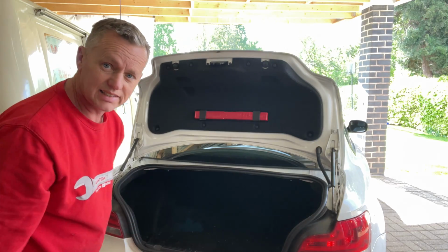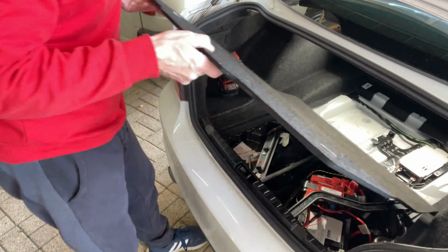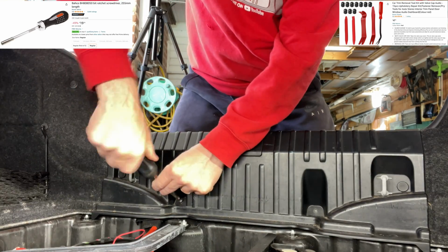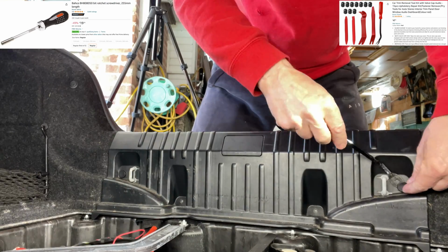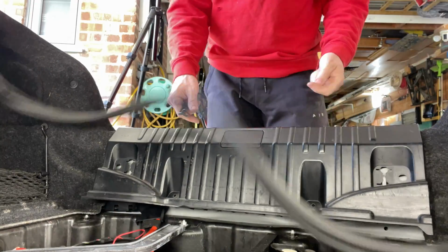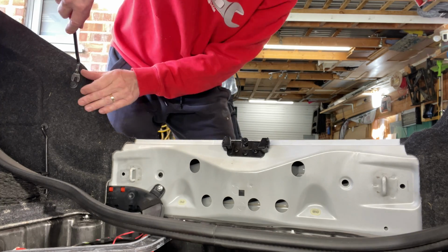Yeah, let's get in there. So first things first, we'll get the boot liner out the bottom. We've got 2 screws on the back panel, just pop those out. Then there's 2 more little press clips. I've got my trim tool there, links in the description for all the tools. We pop the rubber trim off and pull that out, nice and straightforward.